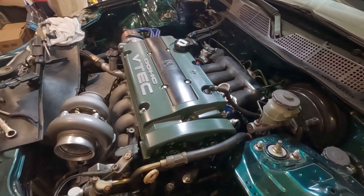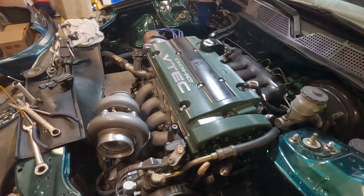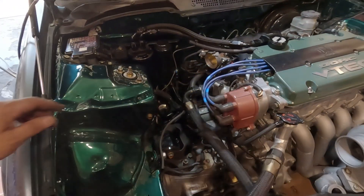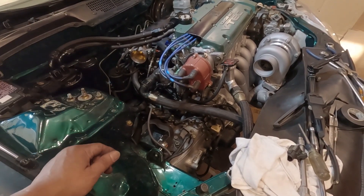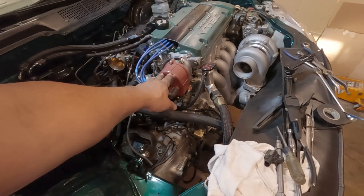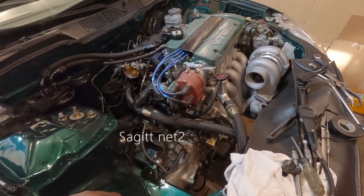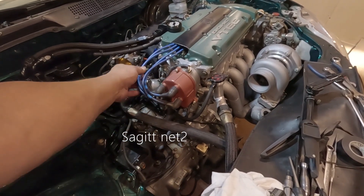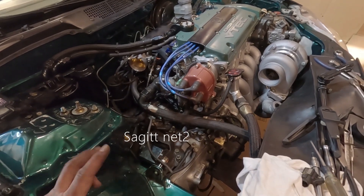For the ignition, I'm keeping it this way, but I do have a Burton Racing coil-on-plugs. I found it's not really needed when you go on boost — this setup is fine, you can make 450 plus on it and not have any problem. But it looks cool though, that's the upside. You can lose all the ignition wires, and it makes it neat.